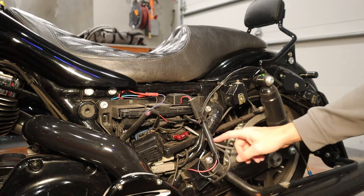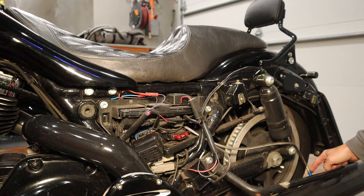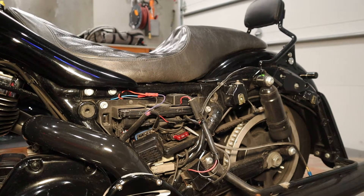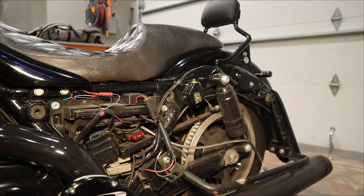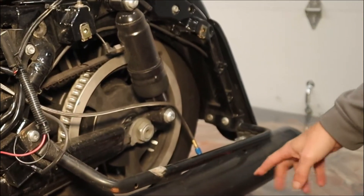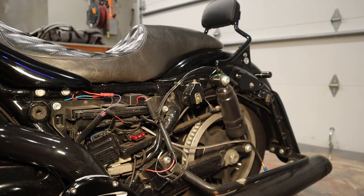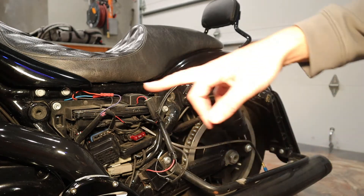This line right here runs gas. When I flip that switch, it's running gas right down into here. At the same time, it's going to be igniting a spark plug that's down right at the end of your pipe. So these are actually Freedom Performance Racing Duals that I have on there with True Dual exhaust.